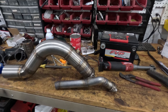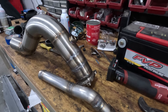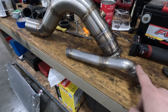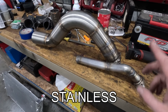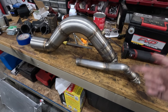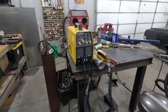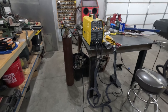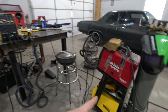Here's the downpipe and the dump tube after welding. Admittedly, this is not my first time TIG welding stainless, but it is my first time TIG welding stainless pipe — so I won't get too close to these welds. These two welds are mine. Everything else — the beautiful welds you see — are from GuillermoFab, not me. For my first time TIG welding pipe, it didn't go too bad. The welds don't look super pretty, but they'll hold and they're all sealed up. I probably had the wrong size filler rod. I'll get a question on what TIG welder I use — I went with a JEGS 200-amp AC-DC TIG welder. I've done a little aluminum welding for intercooler pipe. It was about $540 on sale. I know there are better welders out there, but for someone just learning, it works great. I also have a JEGS plasma cutter and I think it works great too.